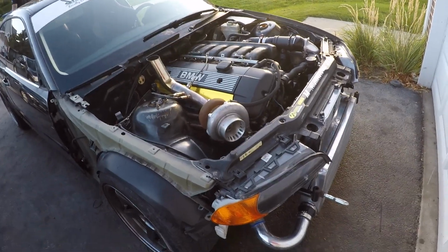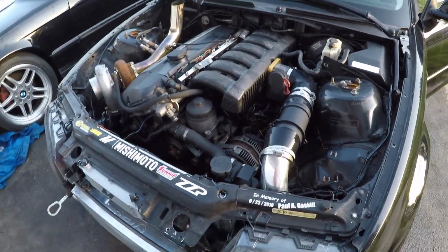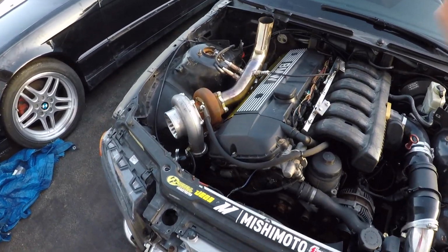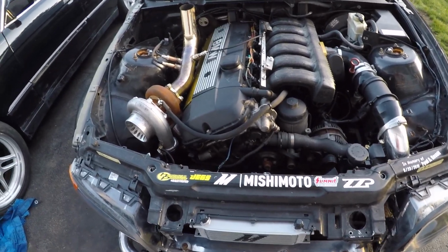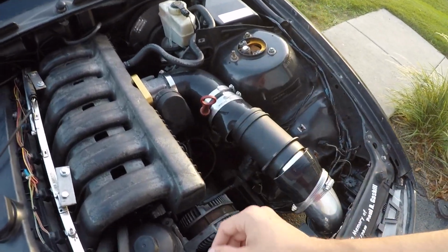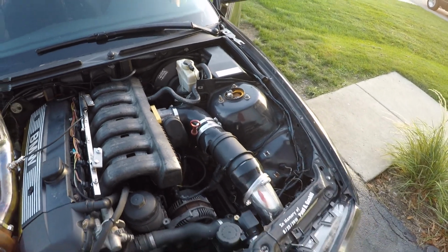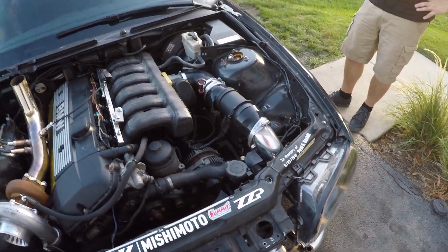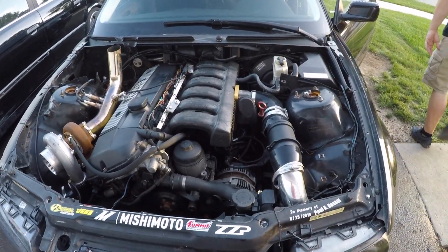Anyways, so there's a couple problems going on. I think I'm going to change the throttle position sensor. This is kind of a good look into what you should do if you're having a problem with your car. Before you start replacing parts, start diagnosing. So what I'm going to do is definitely, for sure, just replace the sensor. I mean, I could somehow do a test, but that's kind of out of my range. But I'm going to be testing the MAF and the harness a little bit later. I'm going to test continuity on the harness, and then pretty much the same thing with the MAF, see what it's doing. And then I'm going to go to AutoZone if the harness is reading okay, and grab a new MAF and see if the MAF just died. Hopefully that would make things a world easier. That'd be amazing.